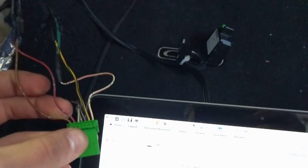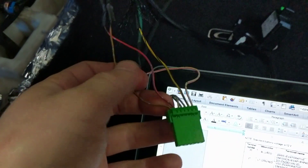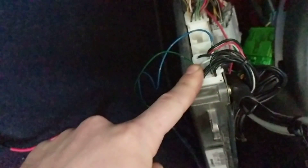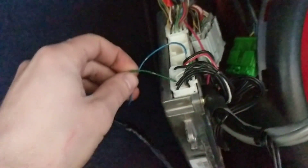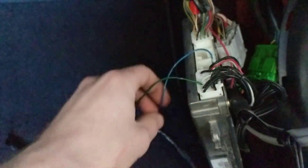We have a brown-yellow wire on the farthest end. This is going to go to E3. I made this nice little harness — it goes to the E-plug. Now this E-plug is part of your conversion harness, so you're probably not going to have pins. I just cut this out of the old D-series harness I had and pinned these guys in manually.